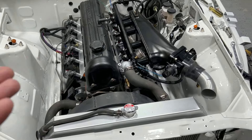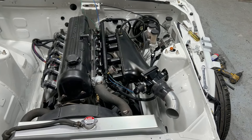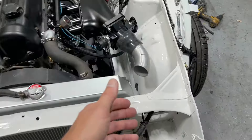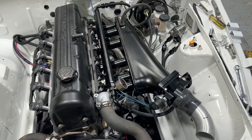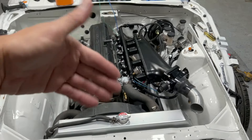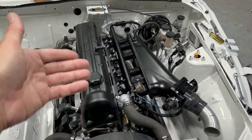I still may build a little shield under here to keep the heat of the headers off the intake — it would help. I've got a little temporary thing here just for the IAT sensor. I'm going to get some three-inch piping to do all that, but I just wanted to hook that up so I can start the car and get some tuning started on it. So the way you wire the injectors is we're going to wire each injector to one of the outputs on the ECU.